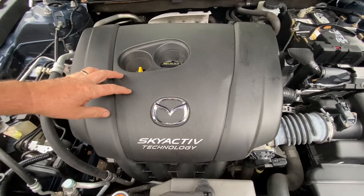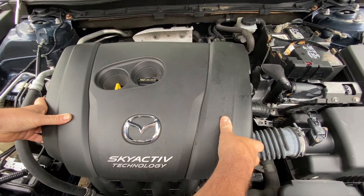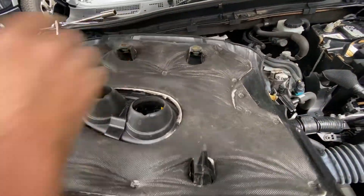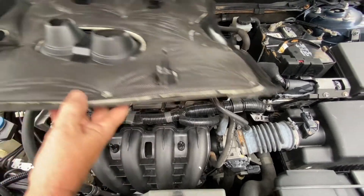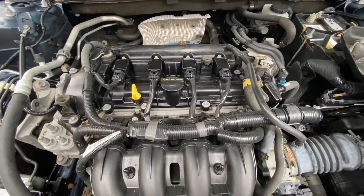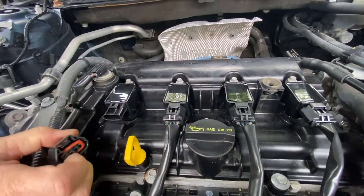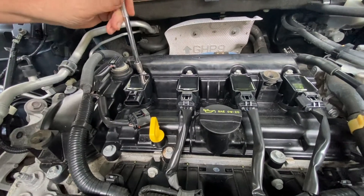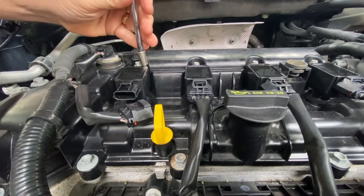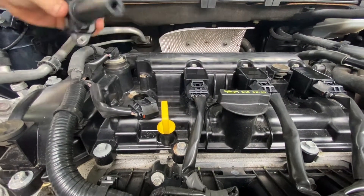On this particular model, removing the ignition coils is very easy. You have a little engine cover held on with pins on three sides — you just push and pull it up. No tools needed for that. There are the coils right there. I've already replaced them but I'm going to show you how to do it. You undo the connector, you have an eight millimeter bolt right here — take that off and they come right off.